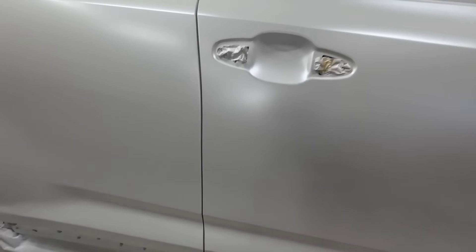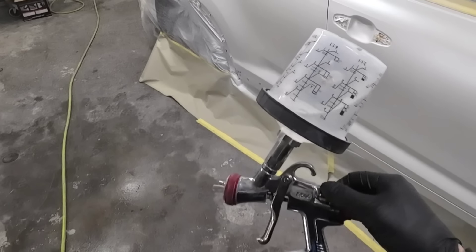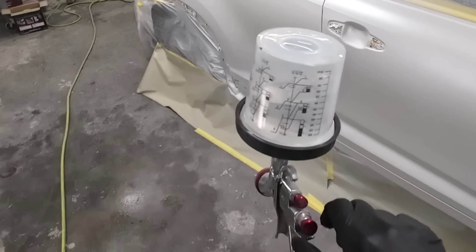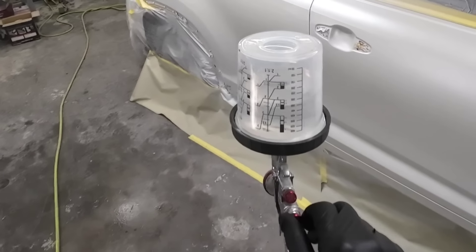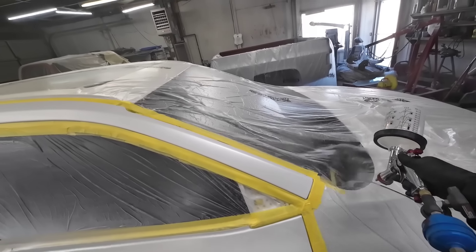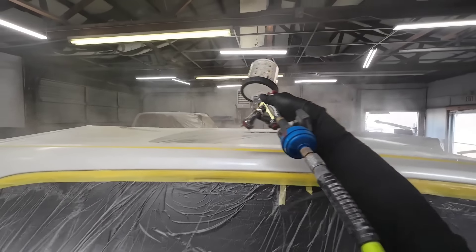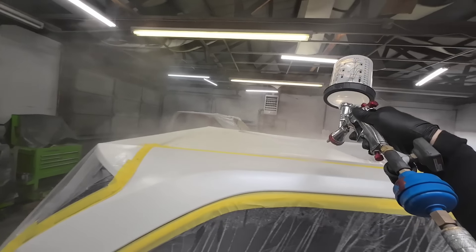Okay, we're ready for clear coat. We've got this pearl white silky smooth — check it out, nice and smooth, ready for clear. Setting up the R500 for clear coat: turn the fan pattern wide open, turn the fluid volume all the way in and then three turns out. For air pressure, I like to turn it up to about 30 PSI — that atomizes it perfectly and gives you a flat finish. I'll put two coats on. The first coat, we're just introducing that clear coat to the surface — not trying to make it absolutely perfect. The reason I'm bringing this gun to your attention is because it's benefited me in the garage and I want to share that with you.